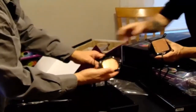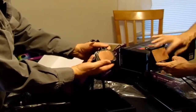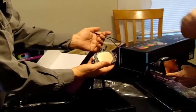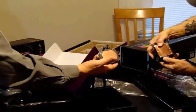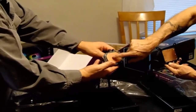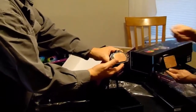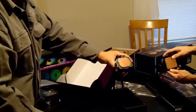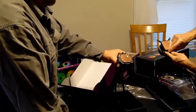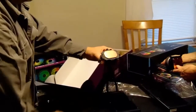But once there's thermal paste in there, you put a good pea-sized blob or however you want to spread it out, whether it's a crisscross, a line, or take a little butter knife and do it like it's toast. It'll fill in the imperfections. You're still going to get a good seal. It absorbs the heat off of the CPU. Nice. Just the look of it makes it look like that's a much better product.